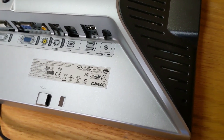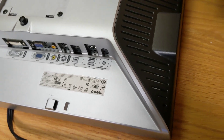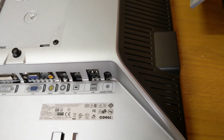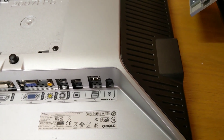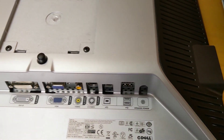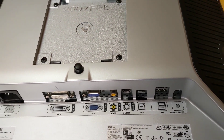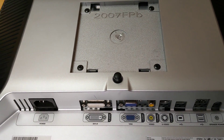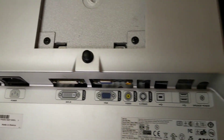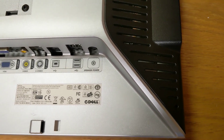We can see the model number looks like 2007 FPB, which is a very strange name. This one has what looks like a speaker power output — if you're running a DVI-D in, you get your sound input and can run out to your speakers. There are USB connections on the side, a couple USB ports on the bottom, and the USB input. We also have our S-video port, next to that a composite video input, plus our VGA input and the DVI-D input, and then the power input. This one looks like it was made in Mexico — the date code shows June 2010, so that makes this one almost a 13-year-old monitor.